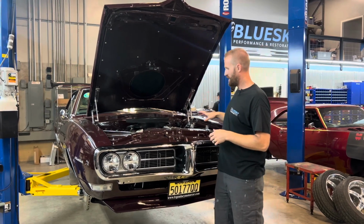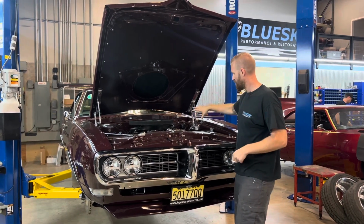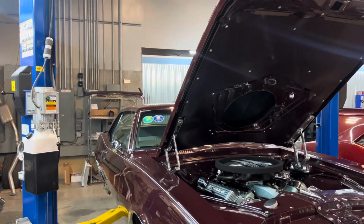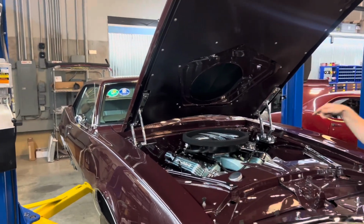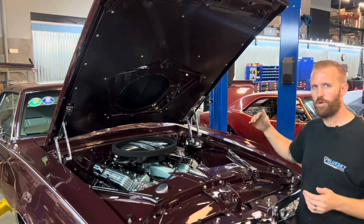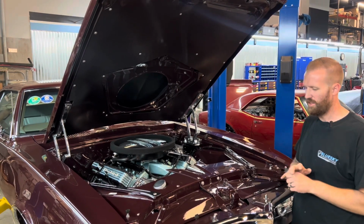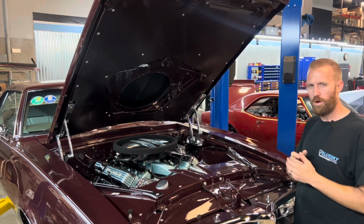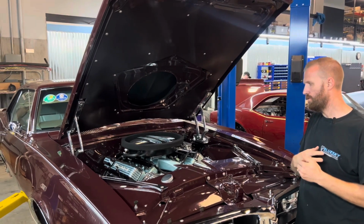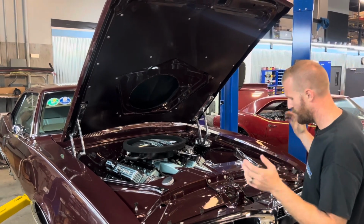Joe loves his shiny stuff, so any exterior stuff is as shiny as it can get. Chrome valve covers from Ogden Chrome, chrome fender braces. It's running a Holley, the Blueprint LS3. Let me rewind a little bit. The 455 a few years ago sprung a leak in the head gaskets. It always ran a little hot, so we did an LS swap with a Blueprint LS376, which makes about 460 to the tire, 540 at the crank, 528, somewhere around there.